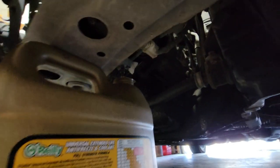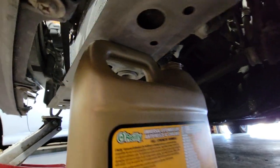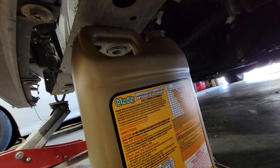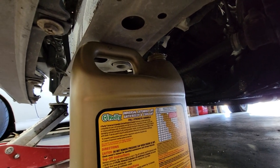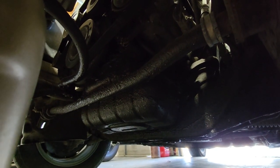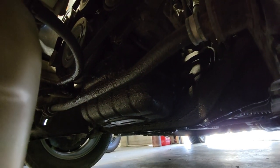Right at the base of your radiator — I'm not sure if this is the same on the IS300, but on the GS300 there is a little valve. I've got the car jacked up just a hair so I can put a coolant jug underneath and recapture all of my coolant to reuse it when I put it back together later. This is a really good idea. To relieve pressure in the system — you can see just how nasty and crusty everything is; it should be absolutely spotless and clean. If underneath your car looks like this, you probably got a leak.